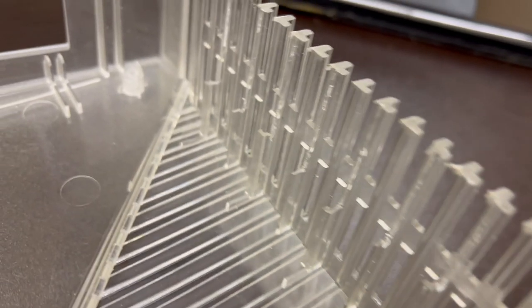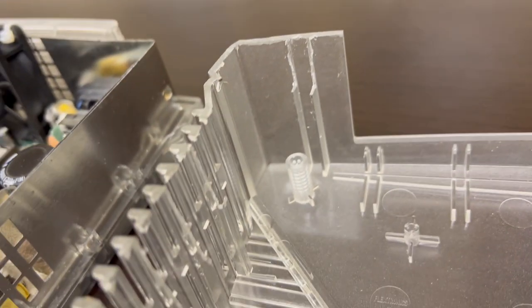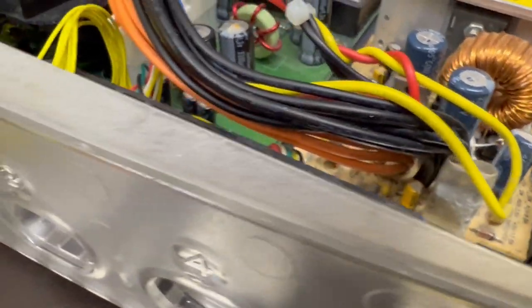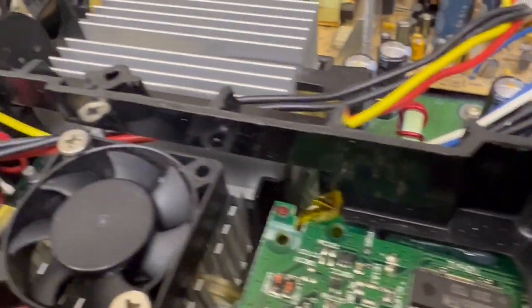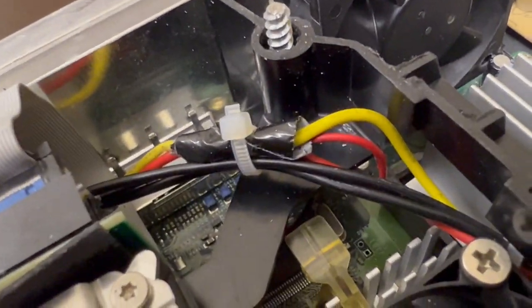Then it's a lot of cutting. You can use this as a guide if you're going to do this yourself — you have to cut off all the rim to lower the profile of the actual Xbox case, and cut off some bits inside just so it fits. Then cut the RF shield down to about that size. Round the front you've got to cut pretty much on the line of the DVD player — that area is smooth, that's the line of the DVD player. The hard drive normally sits on the right-hand side of the case, but I've moved it over to the left-hand side where the DVD drive would have been, which required the plastic in the casing to be modified and slimmed right down.